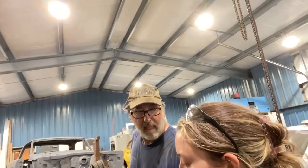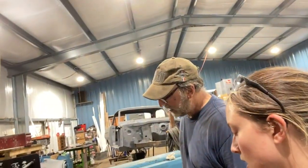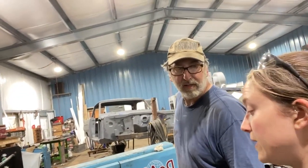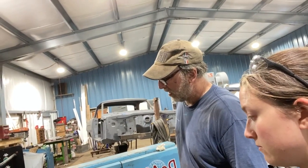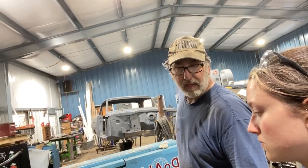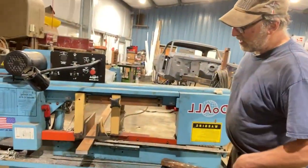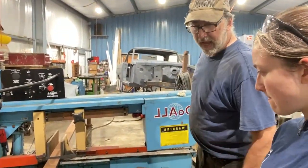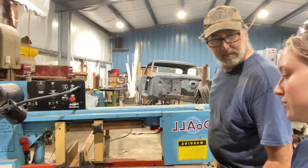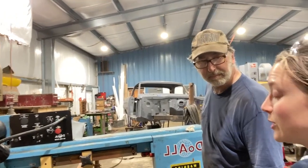Anything else I should be asking you? How long does this take? It takes about three minutes for the saw to cut through each piece. And then, in the CNC machine itself, just to cut out the main form of the main cap — from the bar into what looks like a main cap — just the main shape takes about seven minutes machining time to rough the cap. Whatever I can get out of a twelve-foot bar.